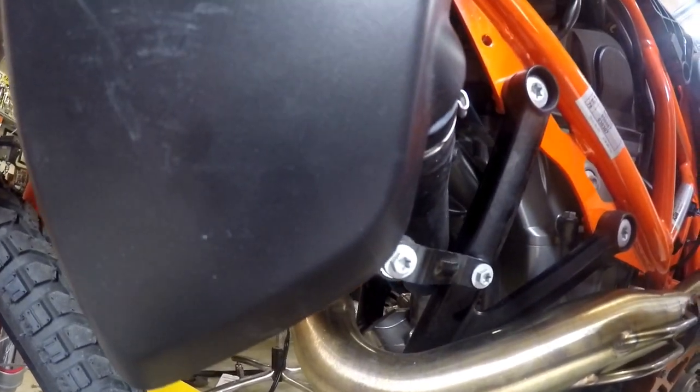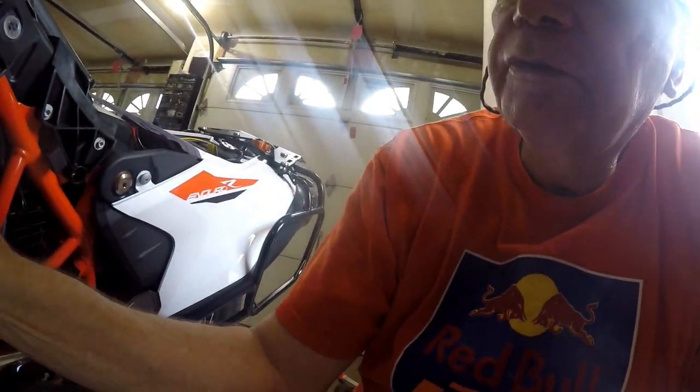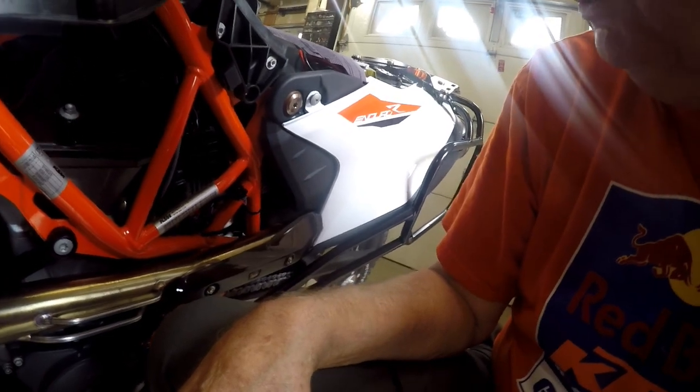It's interesting, the gasket is popping out a little bit on the sides. I don't think there is a leak. Let me do this. I'm going to start it and see if I can feel anything. Interesting. Did you notice when it first started running, something was not quite right, and then the ECU had to figure out what was going on and correct itself? So I'm going to have to do that little ECU calibration thing with the throttle when they get all this stuff attached. Maybe go ride this around the block once just to test it out. Okay.